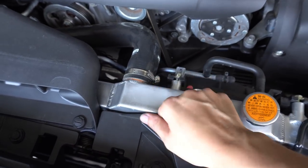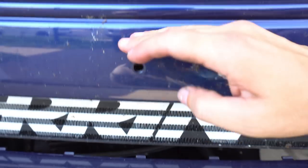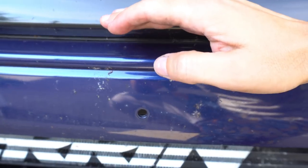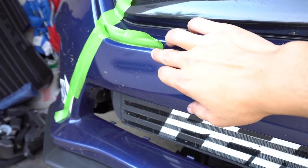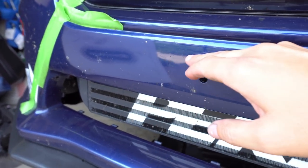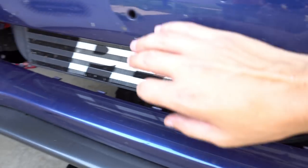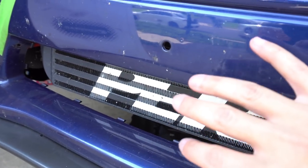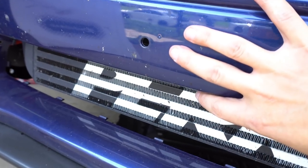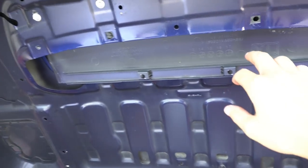Coolant is very slippery on the track surface. Also, I only have this much of the intercooler exposed — the intercooler goes all the way up here — so it's only grabbing this much air. I'm going to cut the bumper opening all the way to the top. I've also learned that because I have a hood scoop, it's creating some kind of pressure and not letting heat escape, so I'm trying to figure out what to do with the hood scoop.